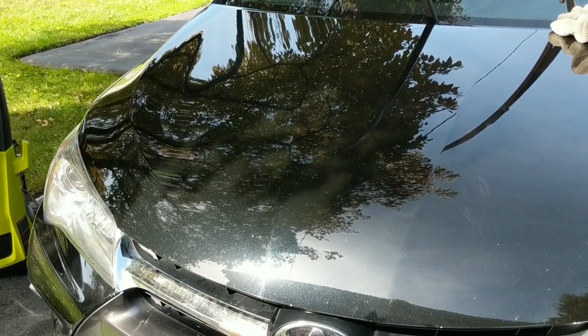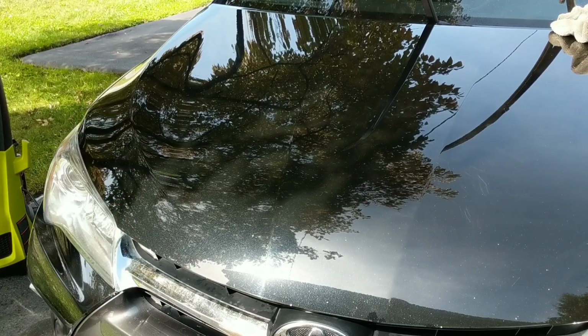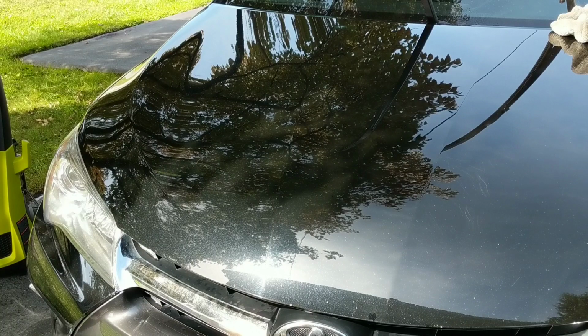it's water-based paint, you could definitely try Rapid Remover first to see if that works. If not, clay pad is going to be your best friend, or even a clay pad for a DA. So we're going to zip through this if we can. I'm going to do each panel with O&R, wash it, then do our clay pad, dry it, and we're just going to go panel by panel, knock this out, and then we'll get to our polished state.